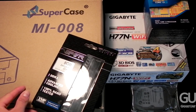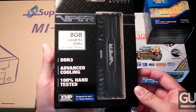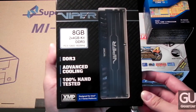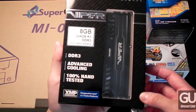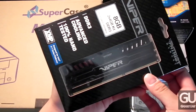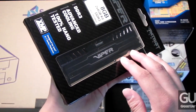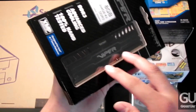Now for a brief overview of each of the five components. First we have the RAM — this is the Patriot Viper 8GB RAM kit, so we have two 4GB DIMMs. It is DDR3 PC3-12800 and runs at 1600 MHz. What I liked about this kit is that it was only $38 from NCIX and it looks really nice, with a black heat spreader as well as a black PCB, which matches well unlike other kits that pair a green PCB with a different color heat spreader.